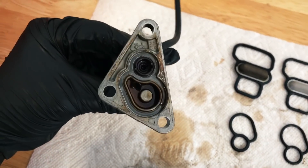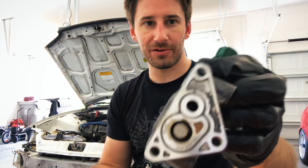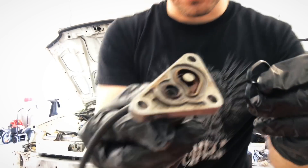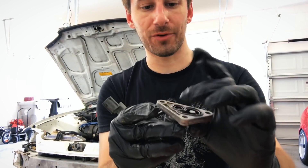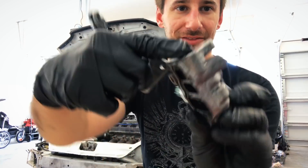I'm going to clean this up just a little bit with paper towel and get that grime off, same thing with the surface up there. The back of the head looks pretty good, but I'll go ahead and clean it up. Taking this new gasket with a little bit of fresh oil on my finger, just going to get it going and pop it into place. This one just kind of presses down in there lightly — you don't have to force it, it just fits right in.